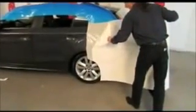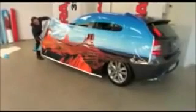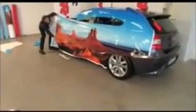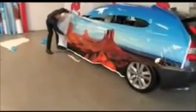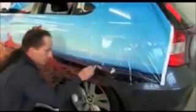The width of vinyl is then folded over, working from the left side to the right, and a further third of the silicone paper is pulled away and cut off. The vinyl width is then, carefully and with slight tension, laid across the vehicle and evenly pressed into place with the squeegee at curved and rounded places, as described for the preceding steps.